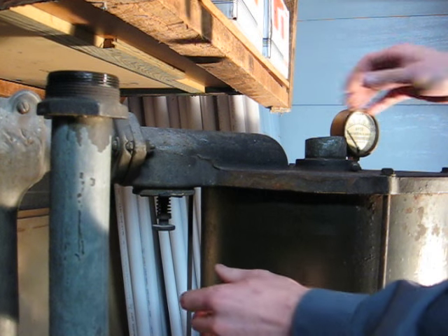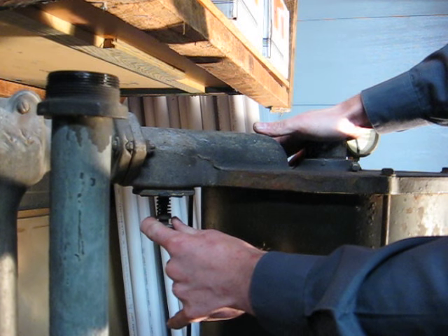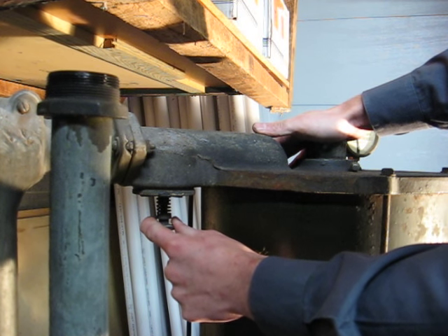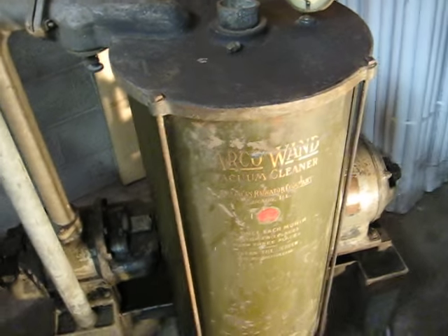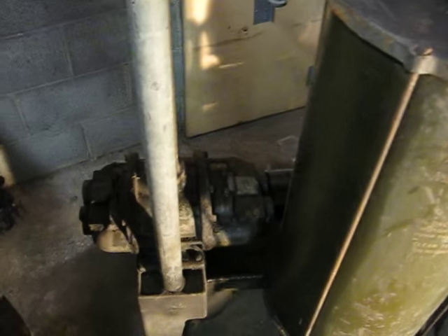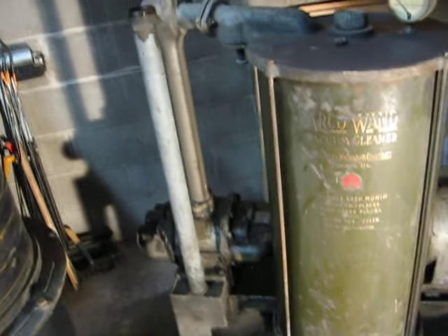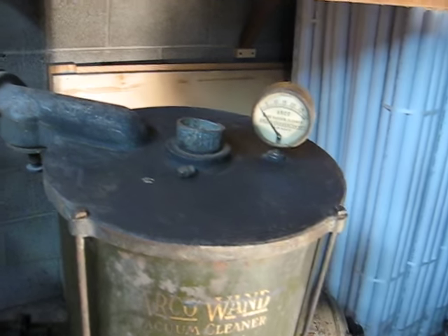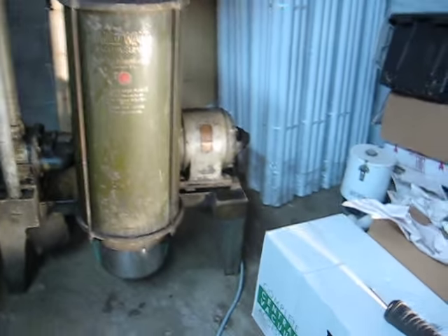And if we hold this relief valve shut, the motor will stall. That's really not terribly good for it. The thing about these blowers is that this size is too small to really exhaust an effective amount of air. So even though it's creating an impressive amount of sealed vacuum, the working vacuum — which is what actually cleans the carpet — is not that great.